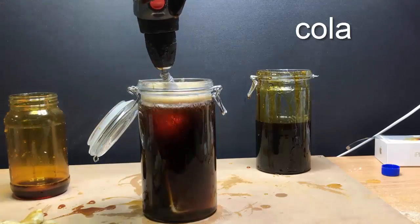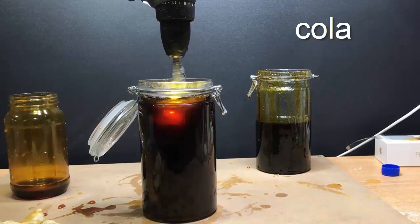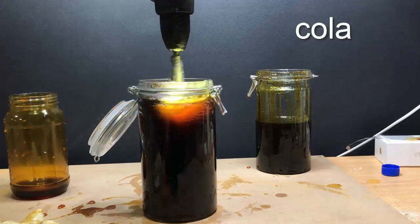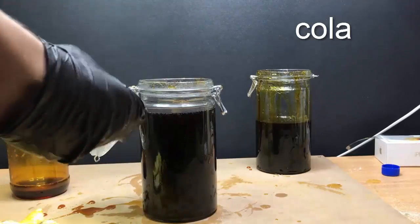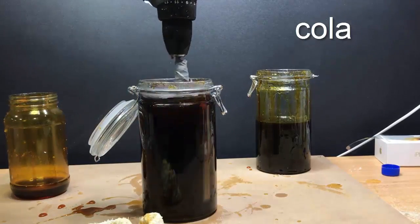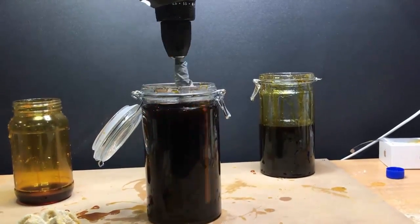The reason I used Coca-Cola was that in previous water-damaged phones I've seen, there was always either red wine or cola that seemed to leave a massive stain, so if there was a leak it would be obvious upon opening the phone after the experiment. And as you can see, once again there are no visible signs of damage or leak to the LCD screen, no triggering of the digitizer, and everything seemed to work fairly normally.